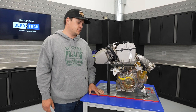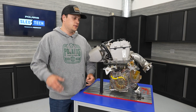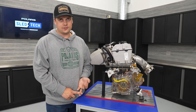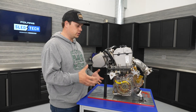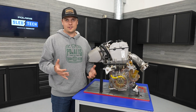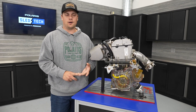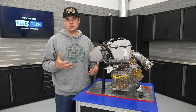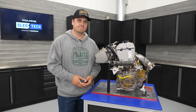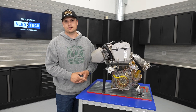So there it is — a deep dive into the ProStar S4, the first four-stroke engine for Polaris snowmobiles in a long time. Super durable with that proven architecture, long service intervals at 4,000 miles, a really robust engine with that dry sump oiling system, and still super fun to ride — it's a Polaris after all. Low center of gravity, fun drive modes, right around 100 horsepower — it really is an awesome, enjoyable engine, whether you've got it in a Voyager, a Titan, or an Indy. That's all we have for today on this episode of Sled Tech. Thanks for tuning in, and we'll see you guys next time.